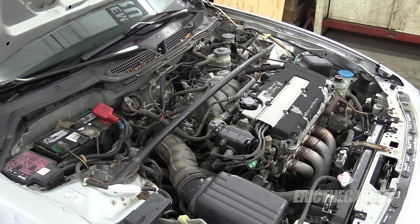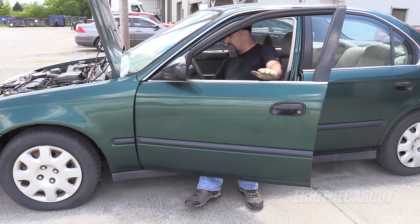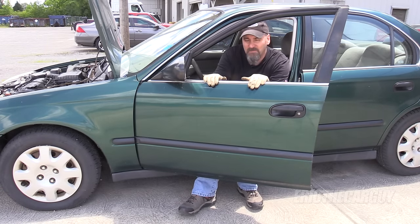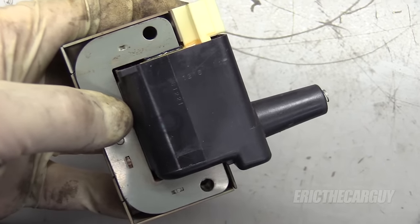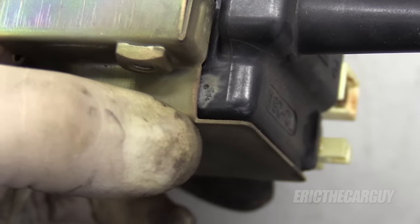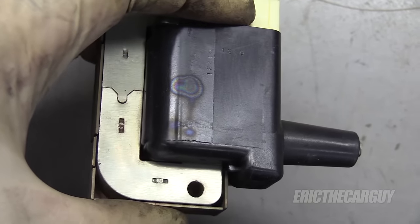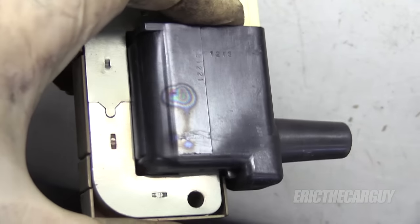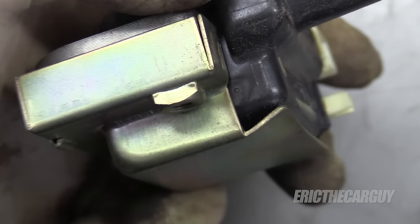Let's see if it still works. I'd say that's a win. The question now is does the Civic still run? Yes, it does. But here's the exception — I ended up replacing the ignition coil in the Civic too. Kind of glad I bought two, because I put the first one in and went to start it up and it wouldn't start. But I did notice something interesting — see that? That looks like a point of failure. So if you have an ignition coil and you start to see these signs on the outside of it, it might not be a bad idea to replace it sooner rather than later. OE parts would be great, but they're super expensive, at least for the Acura. I just pulled the other failed coil out of the trash — shows the same signs in the same place. Well, it all still works — I call that a win.